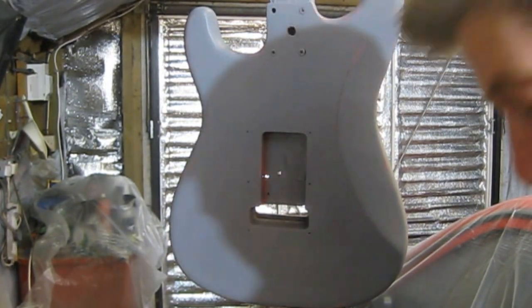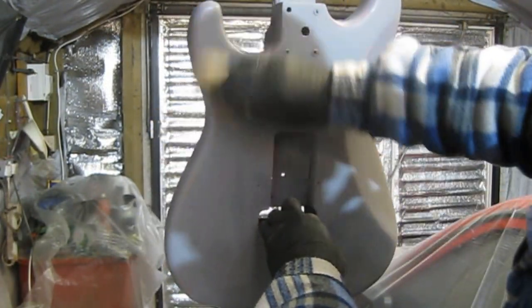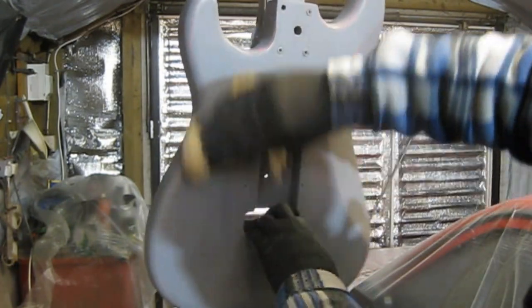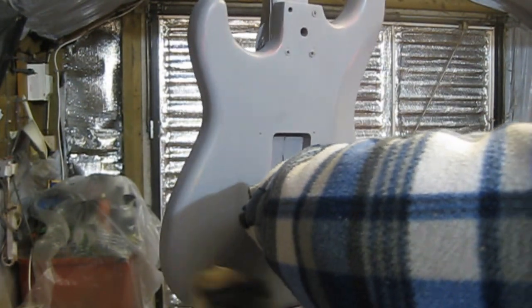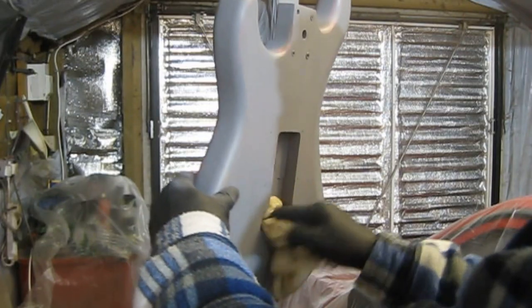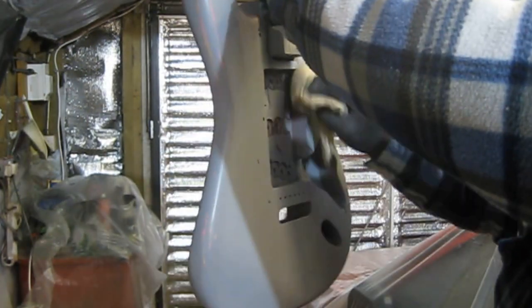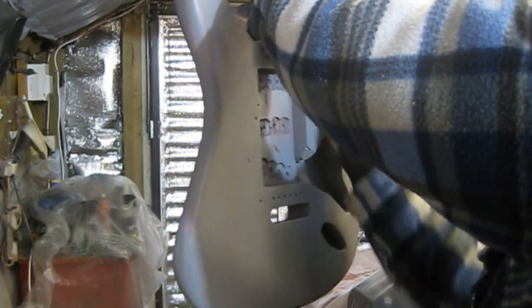I've got the base coat, put that down there for a sec. Right, give this a bit of a tack. This isn't a standard tack cloth, just to make sure there's no loose dirt or dust, and also give it a little bit of a dry as well. Make sure you get all the way around the edges, in the actual apertures as well. Just basically clean, clean, and clean again. Just get it as clean as you can, hopefully.